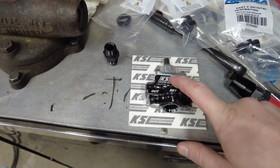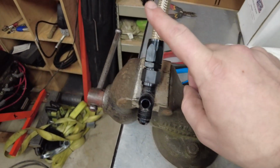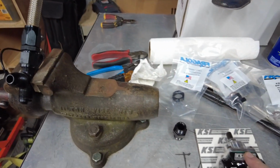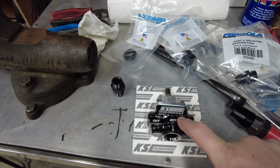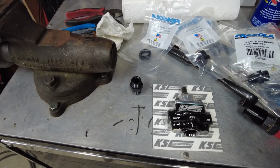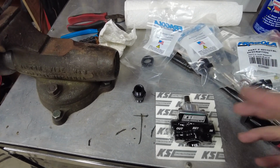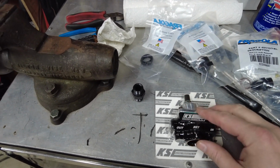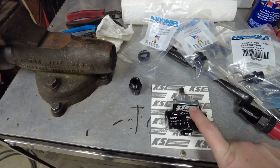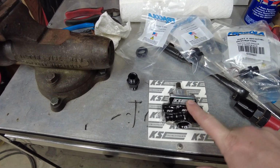Okay, next up, fuel pressure regulator and inlet line. So I got the inlet line all flushed and cleaned. We need to install our fuel pressure regulator to one end of these. So we quit running a regulator when we went to the Willys carburetor, because they don't run one, right? You run deadheaded right off of the pump. The Super Bowl kind of regulates the flow for you. This thing you need with a traditional needle and seat.